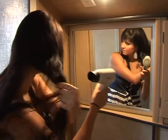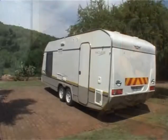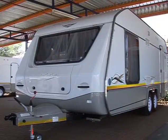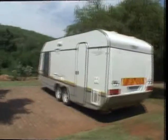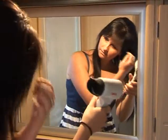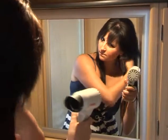The 220-volt power in the Caravan depends on the power available from the source, whether it's from a Caravan park, industrial area, or domestic area. If a Caravan park provides up to 6,3 amps to each Caravan site, you can use only the appliances that do not exceed this limit. Check with the park manager before connecting to the power source.